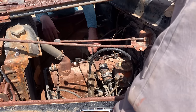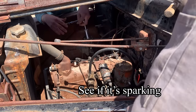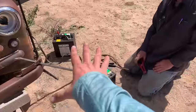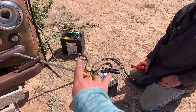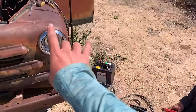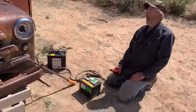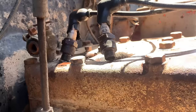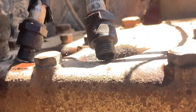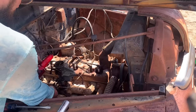Pull at least a couple of them out and crank it over. We got the 12-volt battery that we're using for the starter only, not for the rest of it. We got our six-volt battery to power up the coil, because the truck has to run off six volts. We're going to see if we're getting spark. Yeah, I think I hear it — it's hard to see because it's light but I can hear ticks.